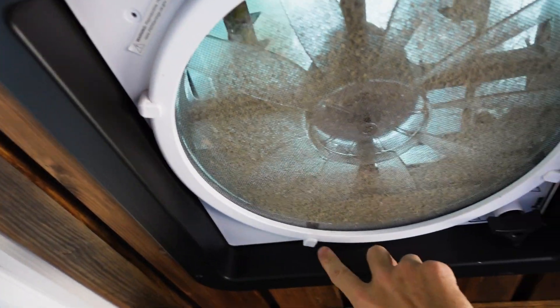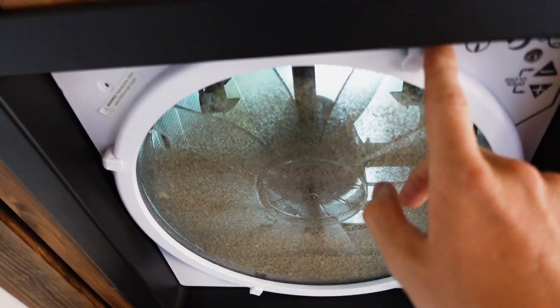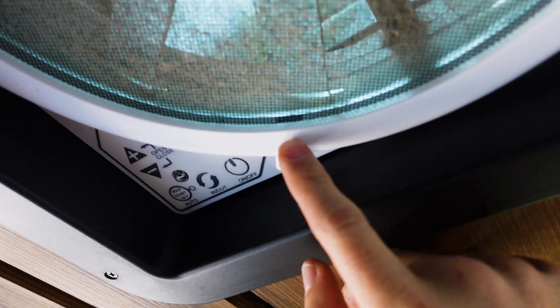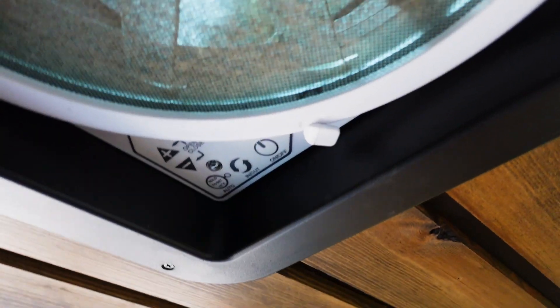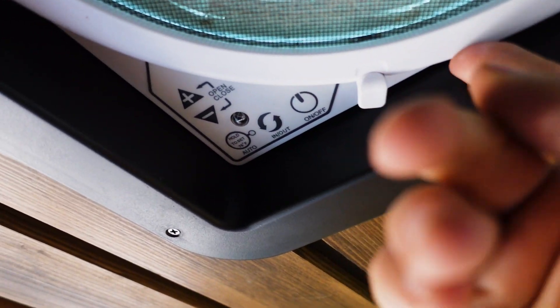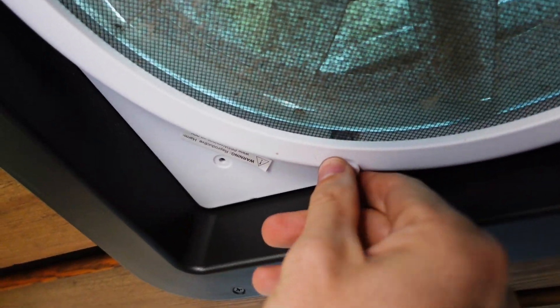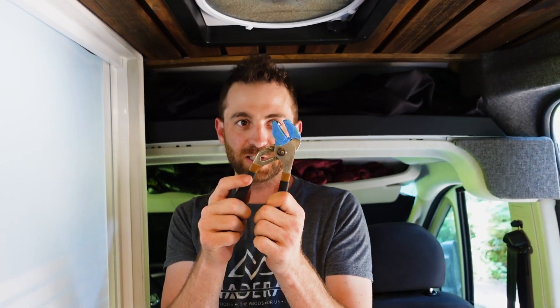As you can see, the screen's held in by these little clips. There are four of them located around the perimeter of the fan. Rather than pulling on them outward — you might be afraid you'll break them because they really don't have a lot of give — you actually take and spin them a complete 180 and that unlocks each one. If you're having a little trouble spinning them by hand, feel free to grab a set of pliers, just make sure you put some tape on it so you don't mar the plastic clips.